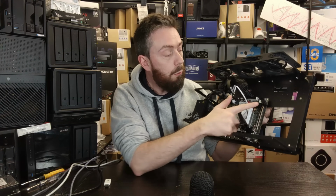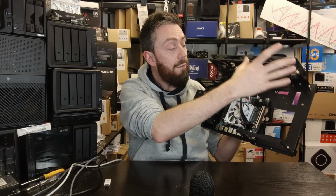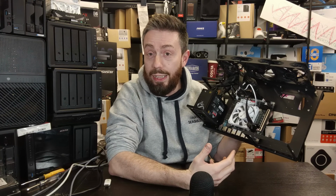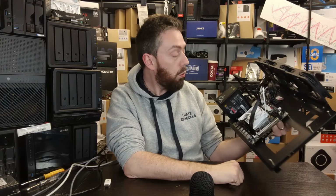Alongside that, we're not utilising the PCIe slot at this time, because even if we did put a card inside this, we don't currently have the storage cage and array ready to start doing some performance testing inside Unraid there, but we will double check that that is, at least in BIOS, down to be an active slot there, whether it's x8 or x16.